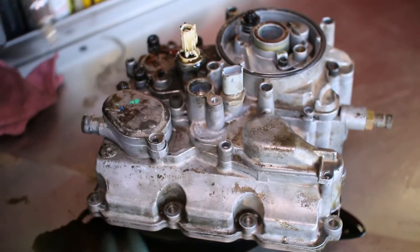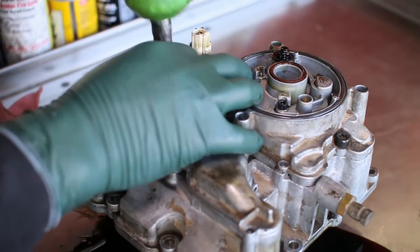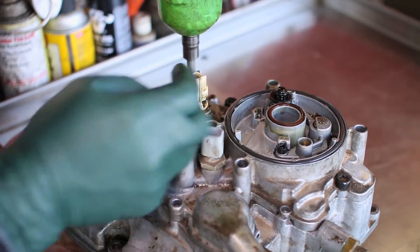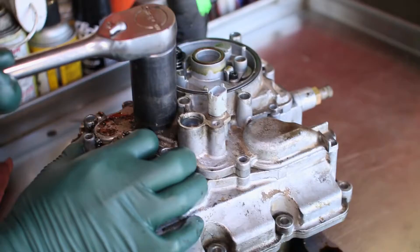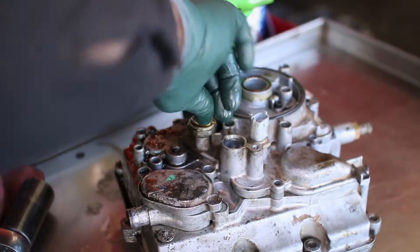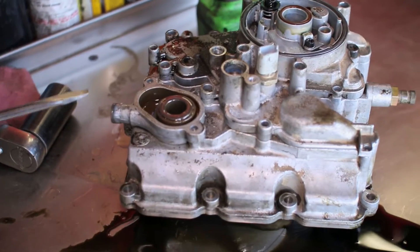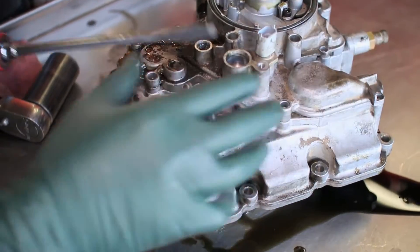The removal of the oil cooler cover and mounting assembly is first. We start by removing the two bolts that secure the EGR coolant supply cover, the eight bolts that hold on the oil filter mounting assembly, and we also removed the sensor. Once all of the bolts are off, we pried off the EGR coolant cover and fork, along with the oil filter mounting assembly.